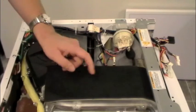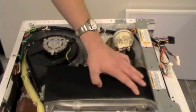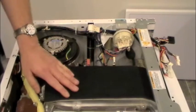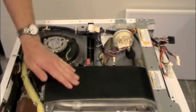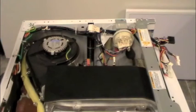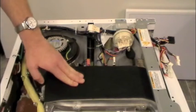Error code E3A basically says it's not drying — there's no heat going on. Because we don't have airflow over the element, the element overheats, pops our high-limit thermostat, that opens the circuit, the computer sees it, pops the error code, and you don't have dry clothes. That's the sequence. We're going to talk about the element in another segment and show how all that is torn down.